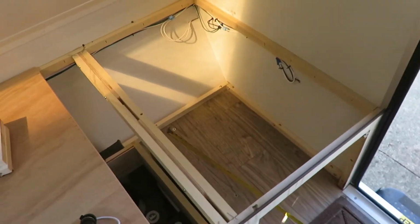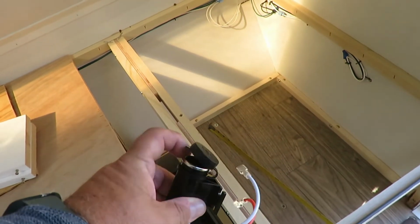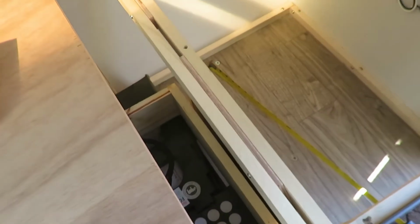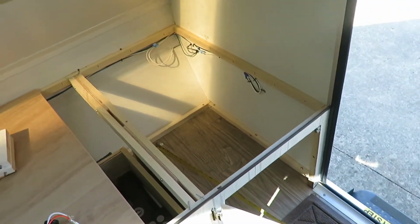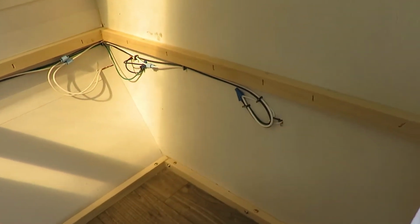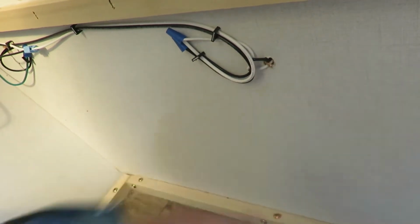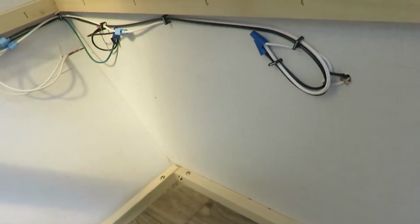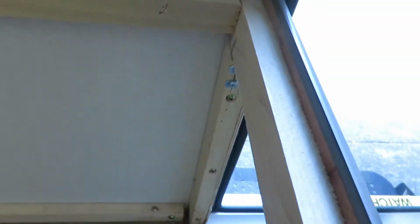And so right now we're working on getting a conversion. We're going to put a 12 volt socket in there for that hookup, and it's going to go in this area. Hole here, we cleaned it out, put all the bedding back, and the trick here is we're going to use the 12 volt that is over here and goes out to the light, the porch light outside. We're going to tie into that, and we're going to probably bring that around the front edge.